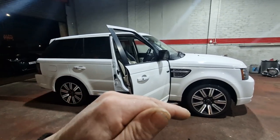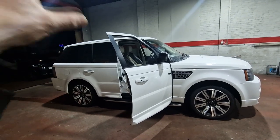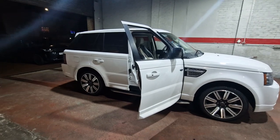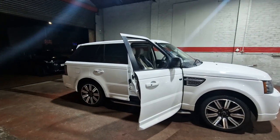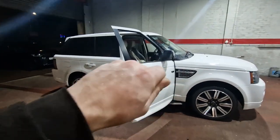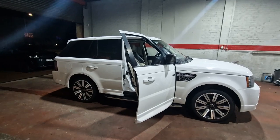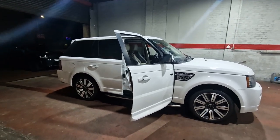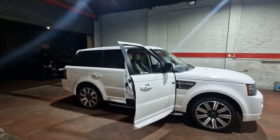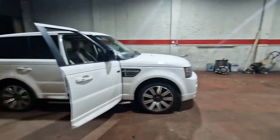Doing it the Britpart way, you're going to need to chop the filter, take the sump off, put a new filter in, put your new Britpart sump kit in, which is a metal pan, holds the filter up into the box. Otherwise you need the body off it to get the bloody thing out. But chop the filter, sorted, with a wee hacksaw blade. So I don't know what's better. I don't know if it's better doing the filter and then doing a second gearbox oil change on it, and then hopefully that way you get it all out, you know what I mean?